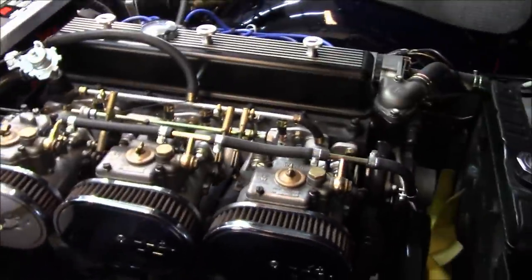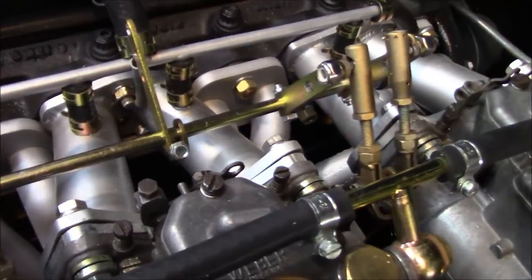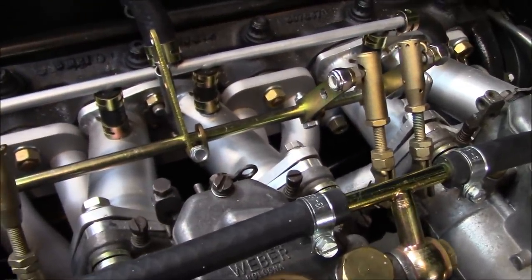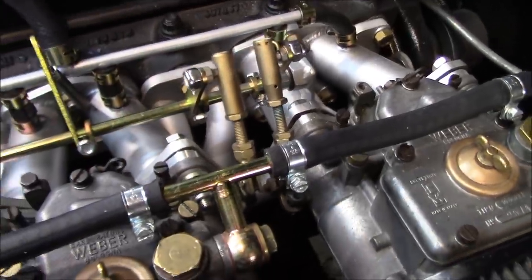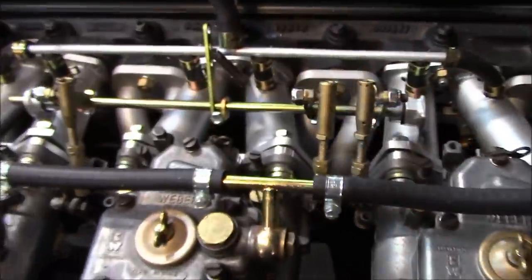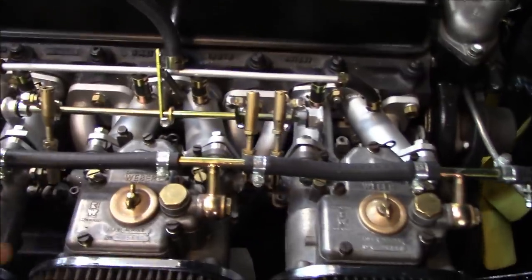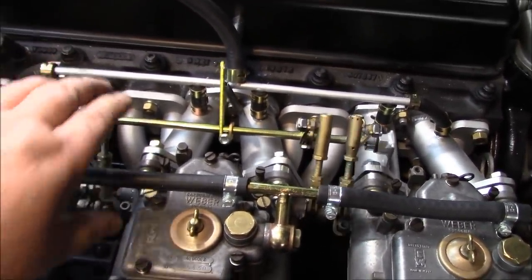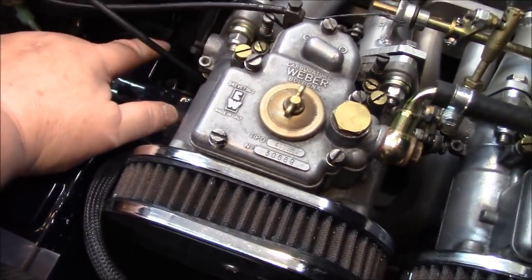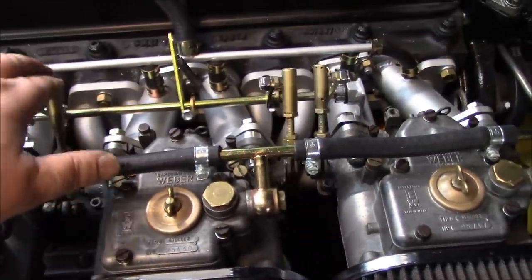Back to this project here — we'll fit that return spring and come back when we're done. We fitted that other arm with the spring attached to the brass nut here on the middle of the intake, so I think that's going to be pretty good. I also raised the arms up one notch to get a bit of a steeper curve on the push, primarily to help with the clearance of my choke cable once that runs through. It returns nicely now, snaps back, and it's not too much pressure. I also added a return spring down here as a safety — a little bit lighter spring — so I've got two springs for the return.